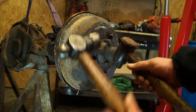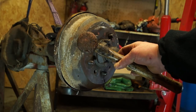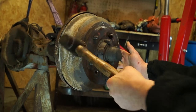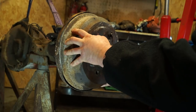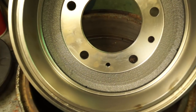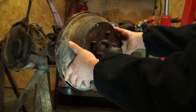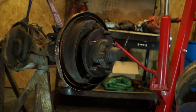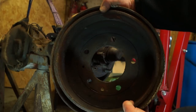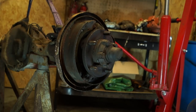There are two ways to tap the drum off — one is using an idiot's hammer and the other is using a copper hammer. An idiot's hammer will crack the drum; a sensible hammer, which is rawhide or copper end, will make sure the drum doesn't get damaged. You knock it and it should come off, breaking the rust seal between the drum and the hub. There is also a threaded hole in the brake drum which will assist you — wind a bolt in to put pressure on and help remove the drum. You need two on opposite sides, which puts pressure on the drum and it will slide off. And then you have exposure to the brake shoes.